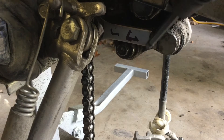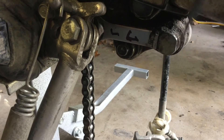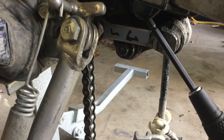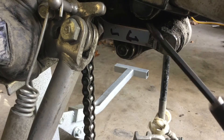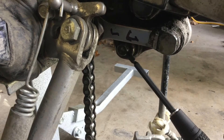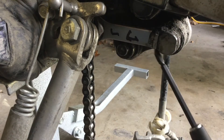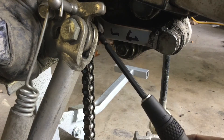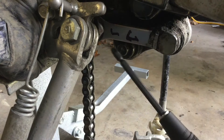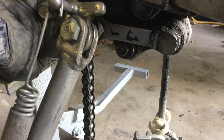On the KLX, it has this edge right here, and these bolt heads have a flat surface, so when you take these off you just have to loosen or tighten the nut. The bolts go left to right, left to right. This is holding the shock on at the rear shock mount — this is just a bolt with no nut. These other ones have nuts on the other side. Hidden behind here is one more bolt that goes right to left with the nut on this side. Go ahead and take those off — the shock will not fall out. Then we'll remove the swing arm by pulling the bolt that goes all the way through the frame.